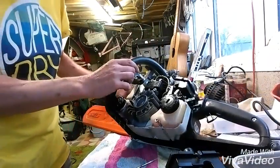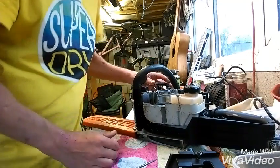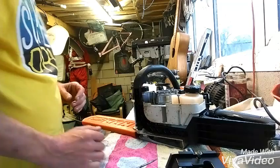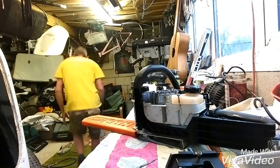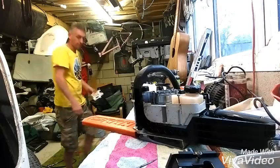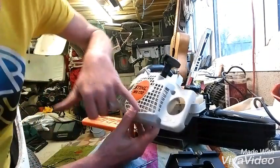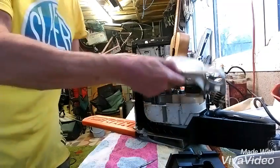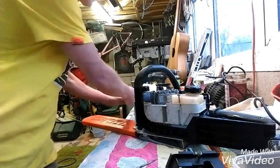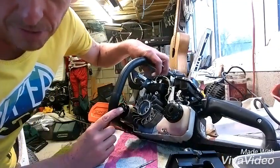The ignition coil - basically there are four bolts. They come off there, that does pull off there. So once that is off, this is what you are left with. As this rotates as you're pulling it, that creates the spark. Because this here - you can see on mine here - these plates there brush against, well there's a slight gap, about a business card gap, between that contact there.